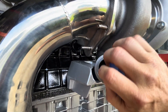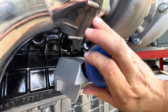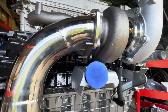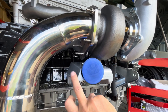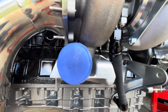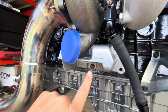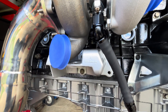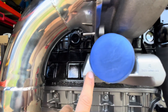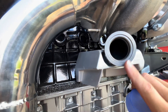I hit a bit of a snag, but as you can see I've cut out the corner of the engine mount bracket — probably the dodgiest thing I've ever done on any car, but this is just a temporary fix just to get things moving. Apparently the fix for this issue is I can use an AU engine mount bracket — a steel bracket that bolts to the engine with a lot less profile — and it should allow me to run the factory engine mount without this issue. I've jumped online and tried to look for AU engine mount brackets but can't find any at the moment, so I've just ground this one out to get me going.